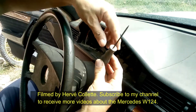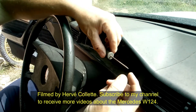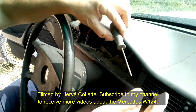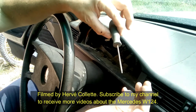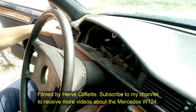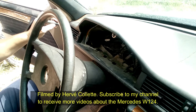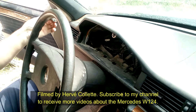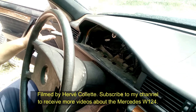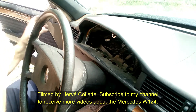I will show you — we need a very fine screwdriver. Here I've got a torx key, very fine. You need something like a very fine knife as well. On the grille, at the top and at the bottom, you will see there are some little clips — two at the bottom and two at the top. You need to put the point inside and make a lever.